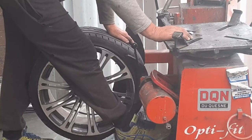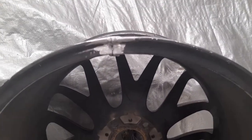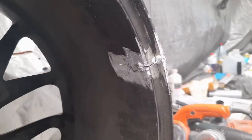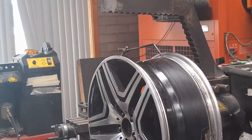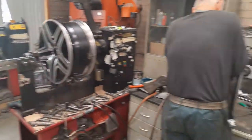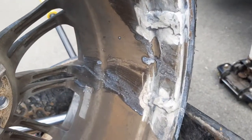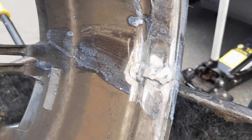Now how can you solve cracked rims? This is pretty much a bespoke job. You gotta remove your tire so you have only the rim itself, and you gotta weld the rim from the inside and also from the outside. Welding aluminum is a pretty difficult task, so they also have to align and straighten the rim as well. Once it's welded, you can safely install it.